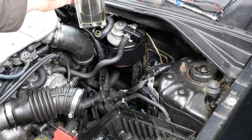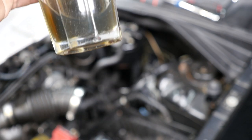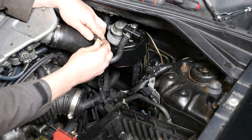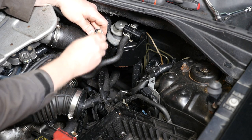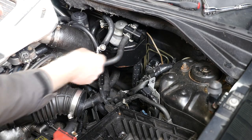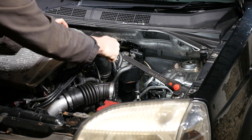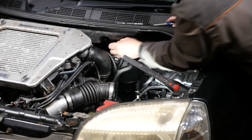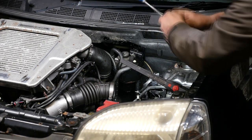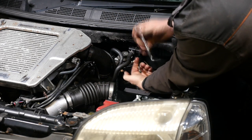As a passing observation, I'm not sure how clear diesel is but this one looks quite murky, so I think that filter is probably well overdue. We'll plug this pipe here, pop a jubilee clip on and just pinch that tight, and then we can work on those two nuts at the back with a 10mm socket. Be careful you don't drop these nuts - they are in a fiddly place. I did manage to drop one but thankfully had a spare; never found where it went, which isn't so good.